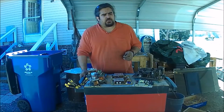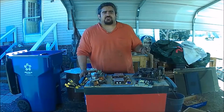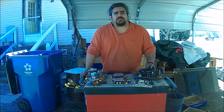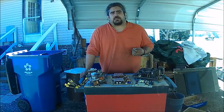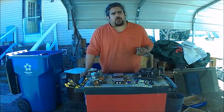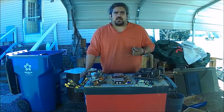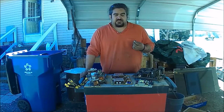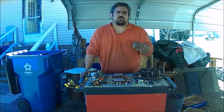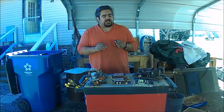It's like people that like to put sound systems in their cars. You can wire the amplifier straight to the battery, but you're going to take the risk of killing your battery, killing your alternator, and whatnot. They have what are called, in short term, power caps, otherwise known as capacitors. The capacitors charge and discharge power constantly when the device is running, and when the device is not running, it holds a charge. It saves your power supplies, your batteries, your alternators, whatever's supplying the power. So, capacitors are a definite need in society.